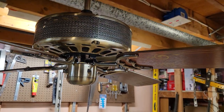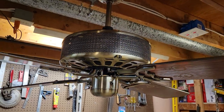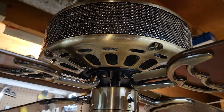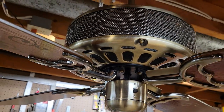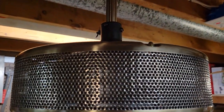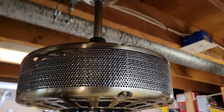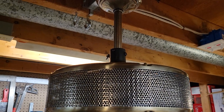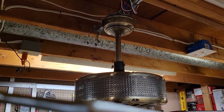The heating system is designed to be used in updraft winter mode, so the ceiling fan turns in updraft. The blade irons have cooling fins attached on top, and as the fan turns that pushes air up through the vents and into the motor housing. The motor in this fan is a giant cast iron 188-by-20 motor with a ring attached to it with a bunch of vanes — it basically acts as a centrifugal blower. Air gets forced up into the motor housing, and those vanes force air outward toward the sideband, which is mesh, so air is forced through the heating elements and out through the sideband. With the fan blowing in updraft, air goes out to the ceiling and circulates around the room.